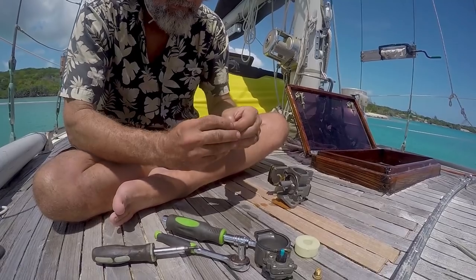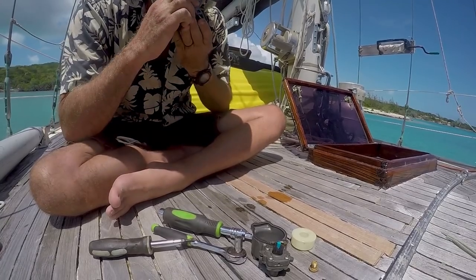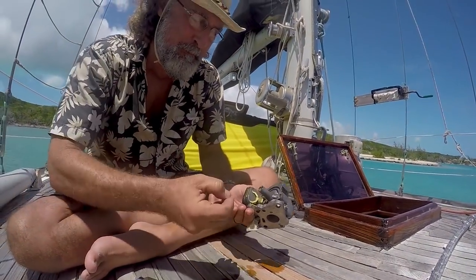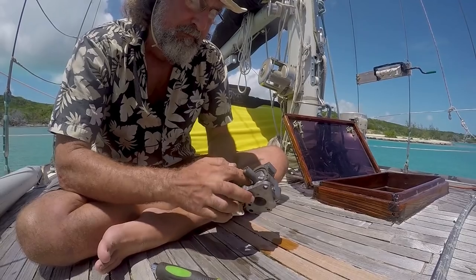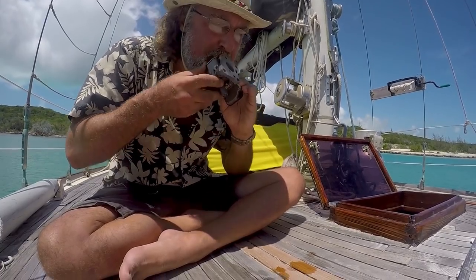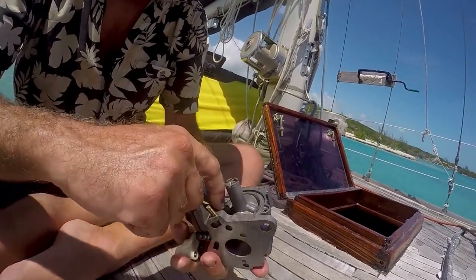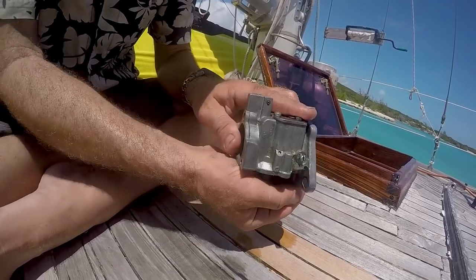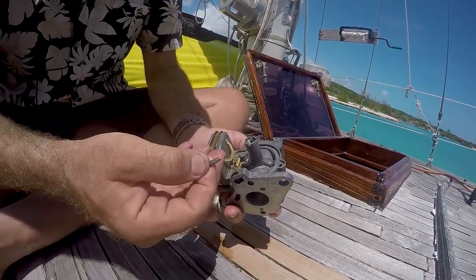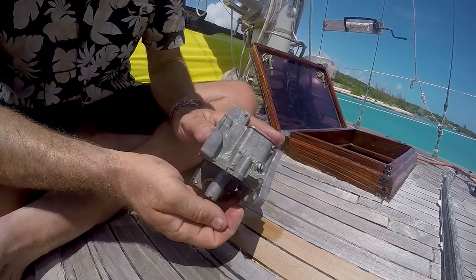Let me take out the needle valve, clean it a little bit, and blow through it again. Now I can blow through it. Gas tastes terrible, especially two-stroke. I'll put the needle valve back in - when I'm holding this up, I shouldn't be able to blow through, and when I let it down a little bit, I should. So we've just fixed the problem. All it was is this needle valve was jammed up in there, probably by some gunge. You notice last time I had to pull it out; this time it falls right out nicely. I don't know what it was, but there was something keeping it from moving. I'm very confident if we put this all back together right now, it would work a charm.